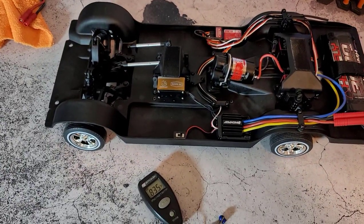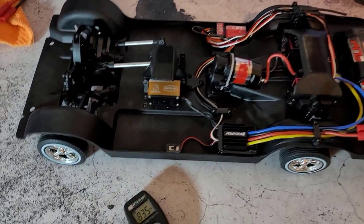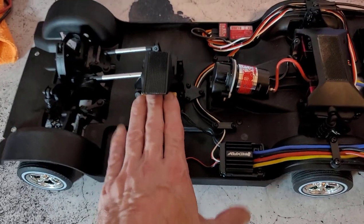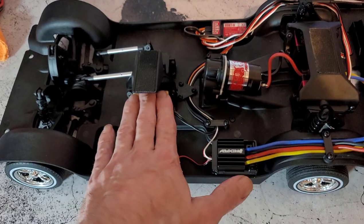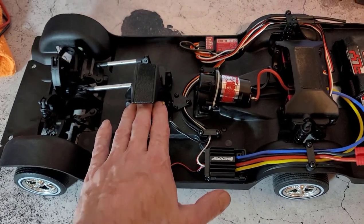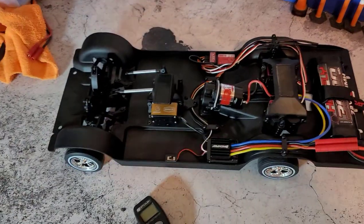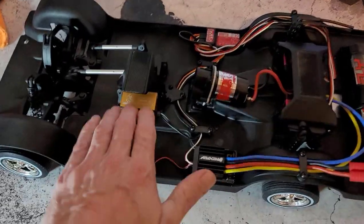So yeah, with that, hope that saves a lot of people their reef servos, so they don't end up burning them up. What ends up happening is that it gets so hot that it starts to lose performance. The hotter it gets, the more amps it pulls, and the more amps is wasted on powering a heated servo, so you're losing power. It just stops working as well once you start burning up those servos, and it's eventually going to burn out.